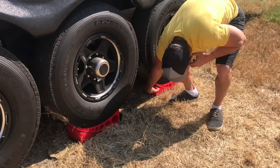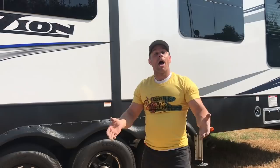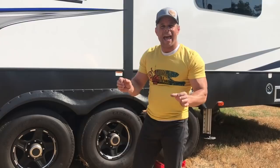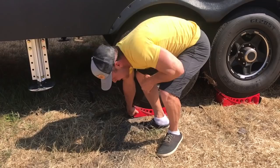Just like that is how they should look. That way, when I go to unhook my trailer, it'll be super tight with very, very little movement, if any. Now one of the questions we get is how do I get my chock out? What I do is hook back onto my RV, put my truck in four-wheel low again, and just barely back up — not very far, barely back up. You'll see it takes the pressure off the chock, then you can pull it right out and drive forward. If you haven't backed up just a little bit, you still have all that weight settled on that chock, so it's a bugger to get out. Just back it up a smidgen and you'll be able to pull your chocks out super easy.